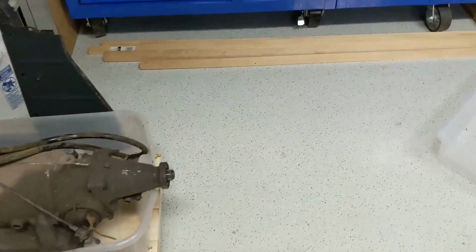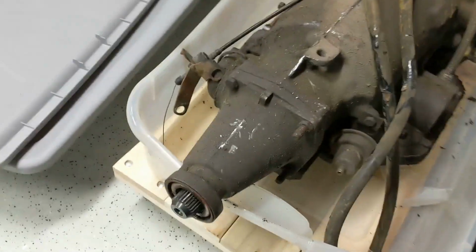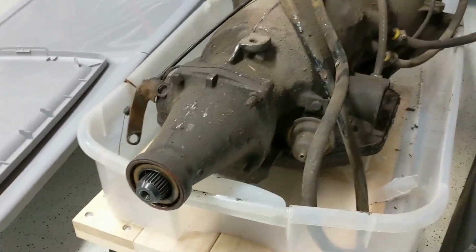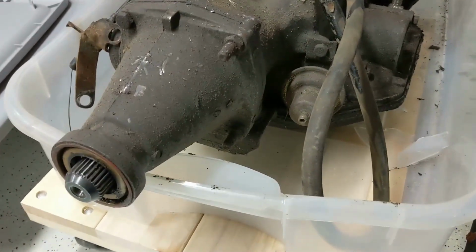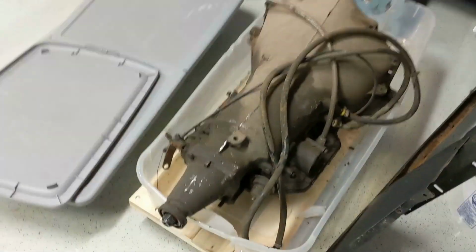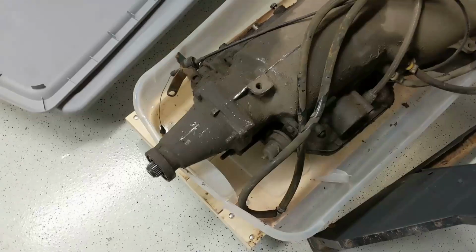If this really did come with that motor, and again, I'll have to check out the casting numbers, but I noticed these two studs. If that motor really did come from, say, an 84 Firebird or a Camaro, that looks like they could be the standoffs for the torque arm that ran back to the rear. So that would put it into like a third gen F body. I grew up working on those as a teen.